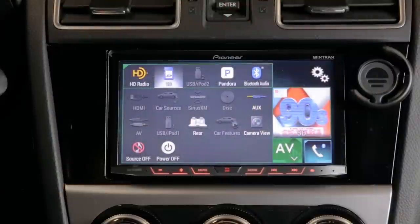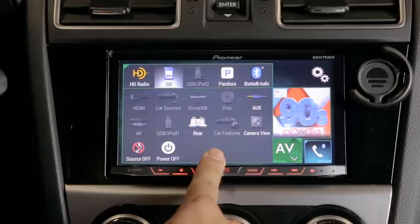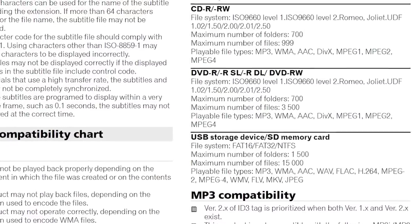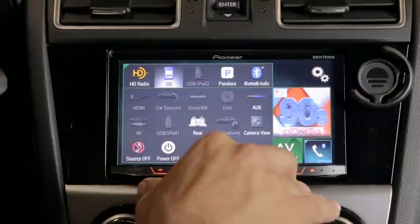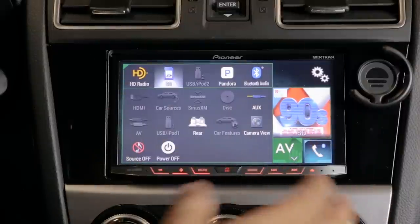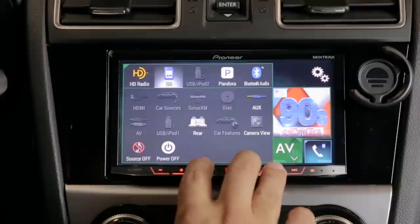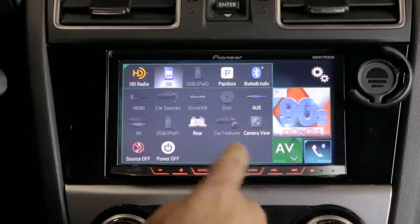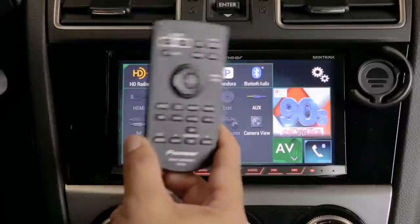The unit has an HDMI port — if you have it accessible in your dash, you can connect HDMI sources and use the stereo as your screen. Sirius XM is available but requires a separate tuner and a monthly subscription. The car plays CDs and DVDs and also plays media files within them, so you can fill a DVD with MP3s or FLAC files and the car will play them. The rear output lets you install a monitor elsewhere — for example in an SUV you can play DVDs for the kids in the back while the front plays music. The stereo also comes with a remote control, great for rear passengers.